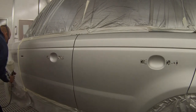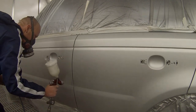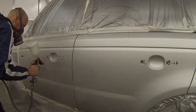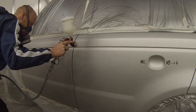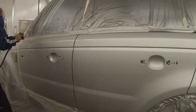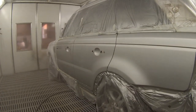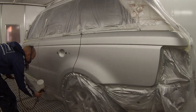The first coat of clear — set up on the gun is wind the fluid right out. It's a GTI Pro with the HVLP air cap on it, so open the fan right up, go nice and close, and 2 bar of pressure or 29 psi. For the first coat you just need to close it up over the base coat so you can't see any base coat through. If you don't, your second coat of clear coat is going to struggle to go on nice and wet if your first coat is not on wet enough.